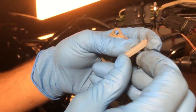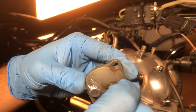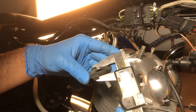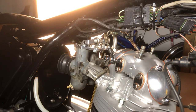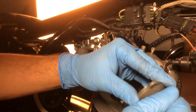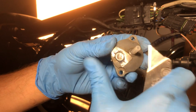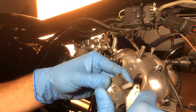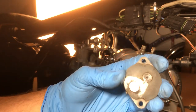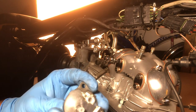Supplied with this kit is a piece of silicone tubing about one inch long. The instructions say to screw it into the carb top about a quarter of an inch — the overall thickness of the carb top in this area is approximately half an inch, so we put it in about halfway down the hole. Screw the silicone hose in, then cut it off flush with the top of the carb, creating a silicone bushing. Repeat for the other side.